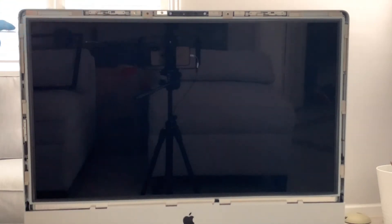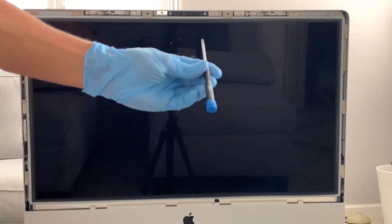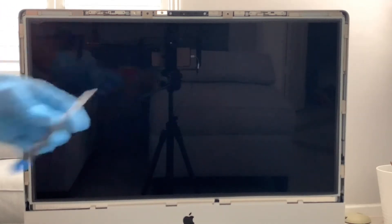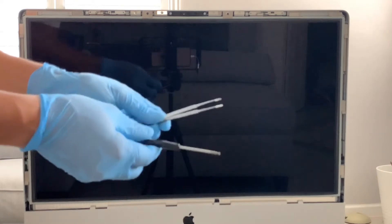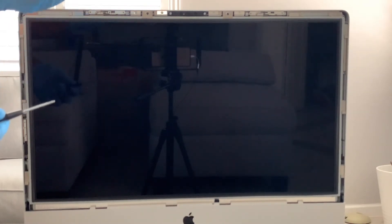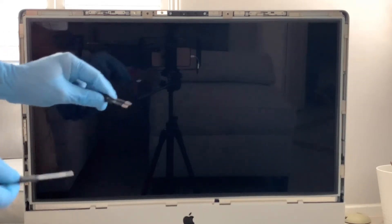The inner screen is held by four screws on this side and four screws on this side. You can remove the screws using a T10 bit — I'll leave a link in the description where you can purchase this. You may also want to use a pair of tweezers because the magnets, when you try to remove the screws, can magnetize them and get them sucked back in. So hold onto the screws with tweezers to help pull them out.